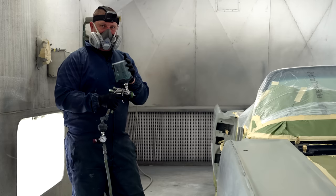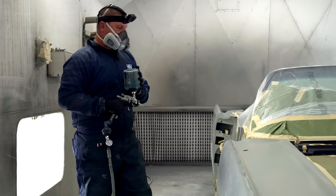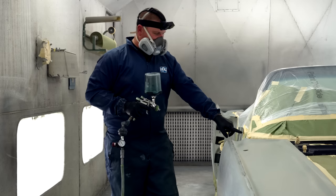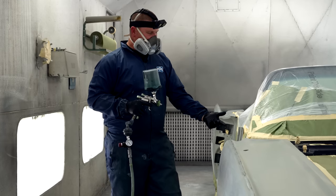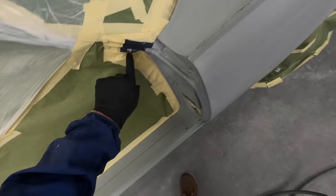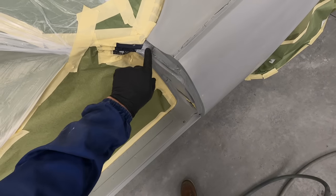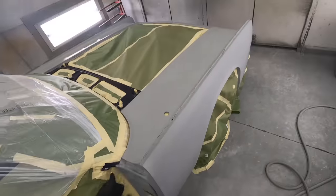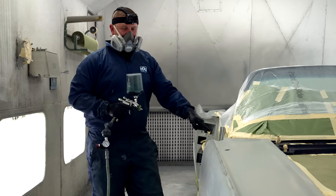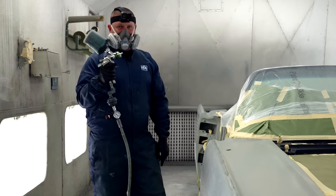That's what the dark gray is for. It's going to make it where I use less paint. For example, let's just say this blue is the same color we're painting the car, so it's not as big of a deal. But right here, where you have these areas where there's primer and blue, you'll see that line because it's lighter. It will take twice, if not three times, the amount of paint to cover that difference than if I was to just seal it.